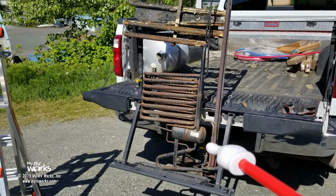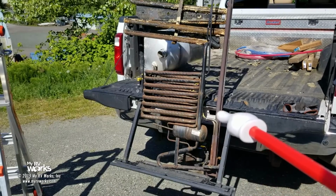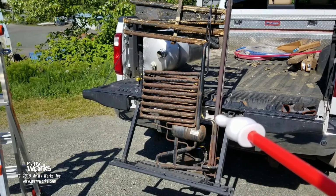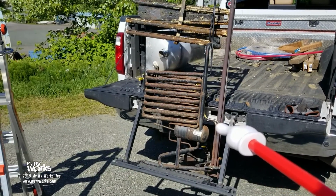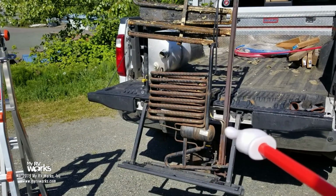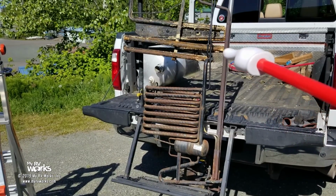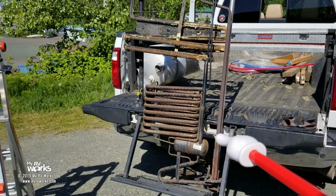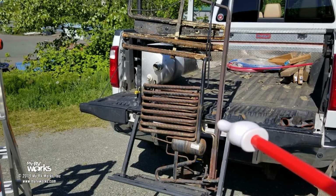Again, I'm going to go into much more detail on all that in another video. But in this area right in here in this boiler, we're going to get that water up to a boiling point. Now this could be anywhere from 300 to 1,000 degrees right at this point. Remember we talked about how ammonia is going to vaporize out of the water. So here we have the boiler tube, and you've got that coffee percolator thing. So here we have a tube within a tube, okay?